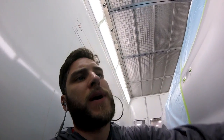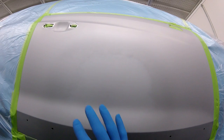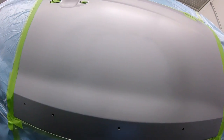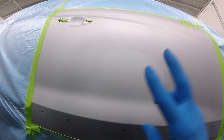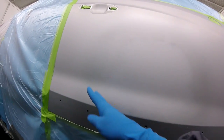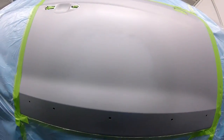So I put one light coat and I'm going to tack it now — I'm going to tack it every single coat. The reason I figured we might as well use a mini jet is because it's going to keep the overspray really minimal and it's easy to tack off. As you can see, the first coat is always going to be transparent, but it's already dry, so I'm going to put a second coat on a little bit heavier, just a little bit farther right, and then we'll see what happens.